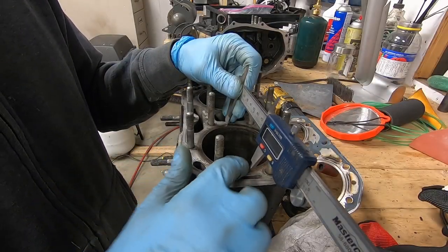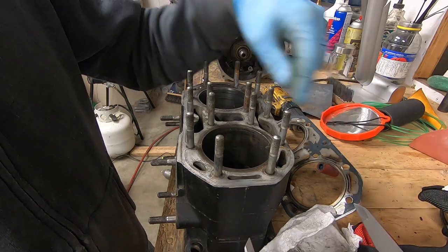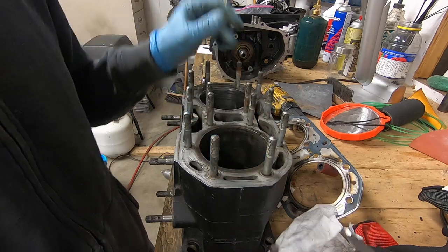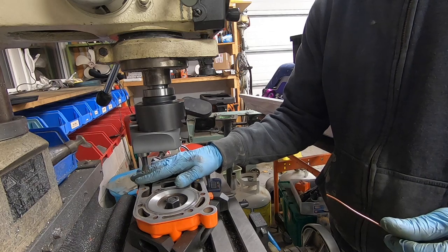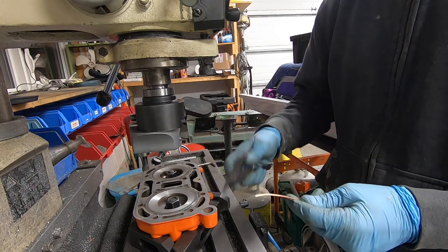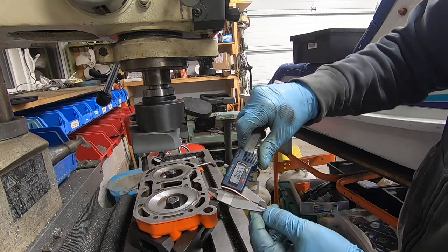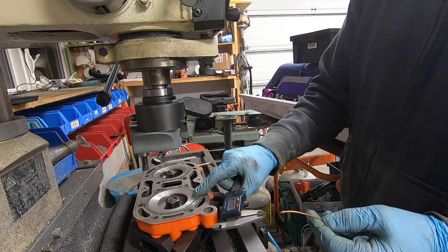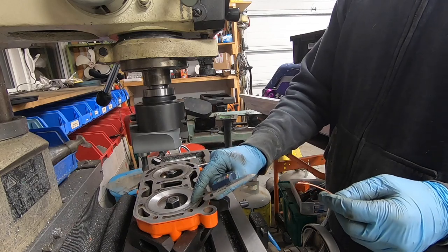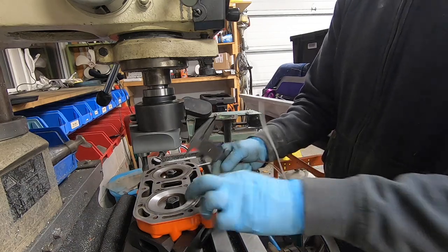What I'm trying to achieve here is making sure that I'm not clamping down on the aluminum — I want to make sure that I actually have the copper so that it's seated down on the top of the cast iron sleeve. After much head scratching and adjustment, I've got the cutter where I think it's going to work. I've got my wire here and it is 65 thousandths. So for starters I'm going to cut 35 thousandths deep into the head, then sit the wire in the groove and see what it looks like.